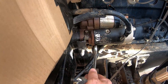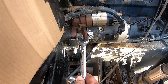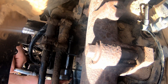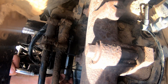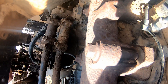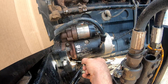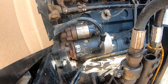You need a 17mm and an 8mm allen down here. I like to do the 8mm allen last because it keeps everything snug and it's the easiest one to take out. Sometimes you might need a crow's foot or an actual wrench to get it started. A socket makes it easier but you can't take it all the way out — finish it with your fingers. I'd advise using a long allen with rounded head tips for this one — though I'm not using one because I don't have one.